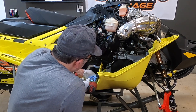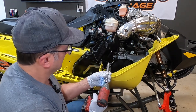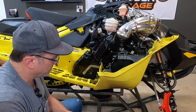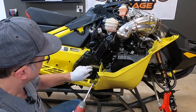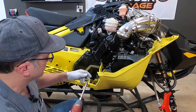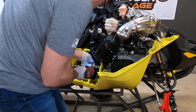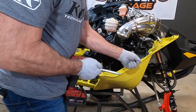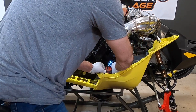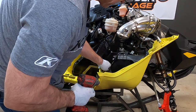There's one down here that's hard to get on. Now when we do this, you want to check your chain probably at least once a year just to see what its condition is. These are T40s — the other ones are T30s — there's one here and one here. Make sure this one goes on where you have it. This one has a little copper washer on it that keeps oil from leaking out because it goes right through the chain case where the oil is. This is really the one I've seen strip before because it's pretty tight the first time.